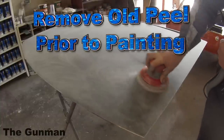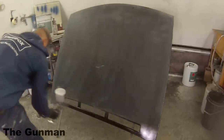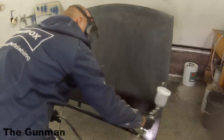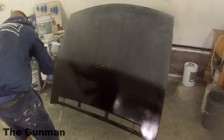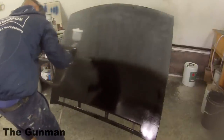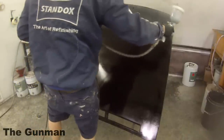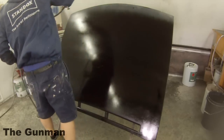From my experience, no matter how good you try, unless you're painting a dead flat panel — say if I was to paint that hood laid down flat — I'd be able to get it pretty flat. But as you're painting a panel on the side of a car, you're always going to have a little bit of orange peel. It's always there from factory unless you rub it right back and polish it up.